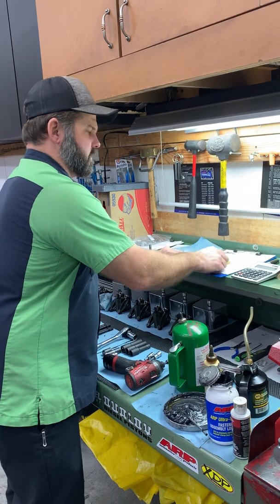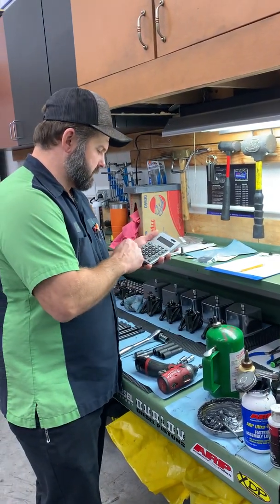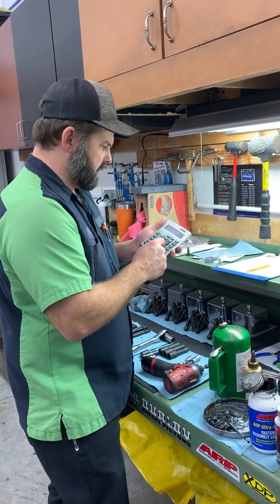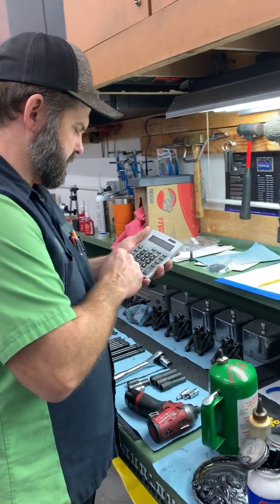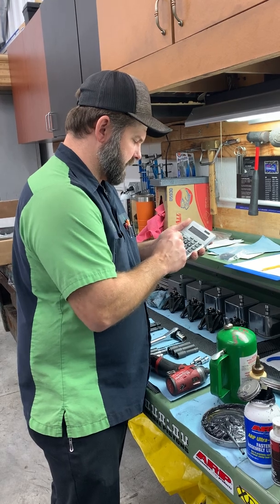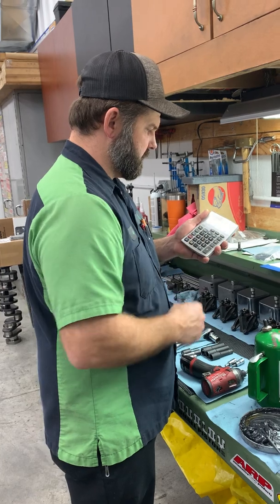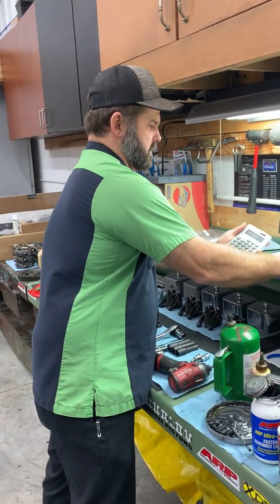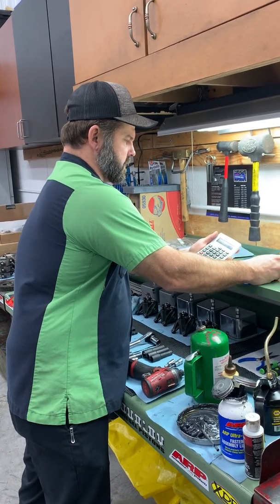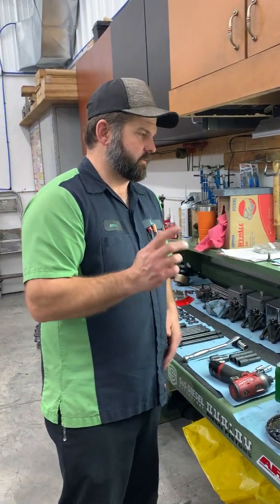I do this all the time. I degree every Cummins cam, and we use Hamilton cams in all of them, so I know all these numbers. I know we're right in the ballpark. 58 plus 137.5. So we're adding both measurements together, dividing it by 2. 97.75, so 98 degrees. So our center line is 1 degree advanced from the cam card.